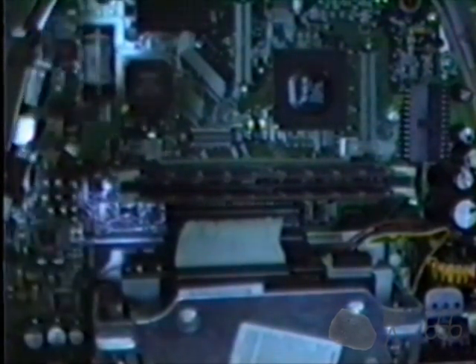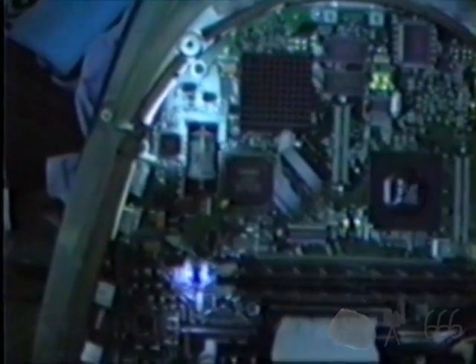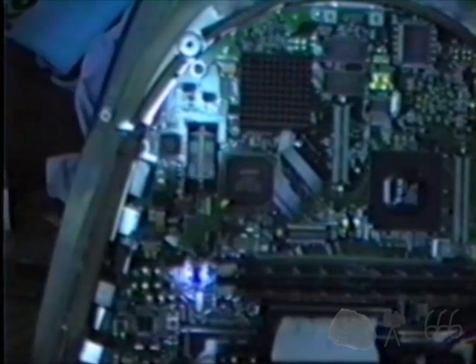So I'm going to put this back together and we're going to give it a shot, see if it actually still works. So that is how you replace the clock battery in an iMac G3 slot-loading machine — maybe not so correctly because I did break that little thing on the sides. This battery can probably fall right out. Hopefully it doesn't do that. Now it is time to check over our work, so we'll go ahead and fire the system up. The system needs new speakers as well — I probably should have done that while I had it apart. I know that the hard drive is also having trouble in this machine.